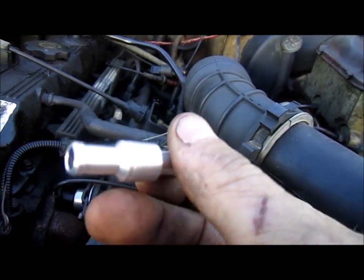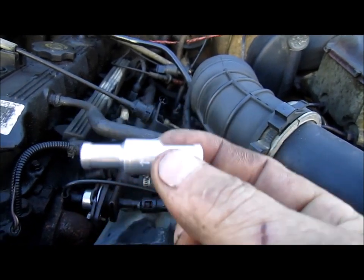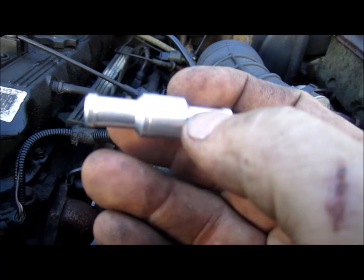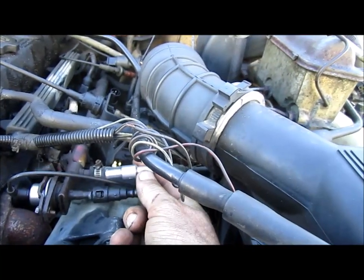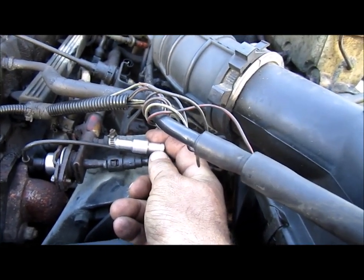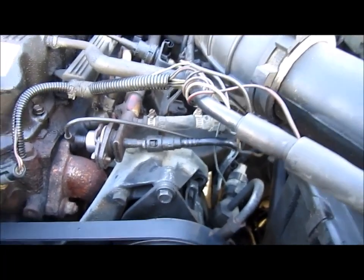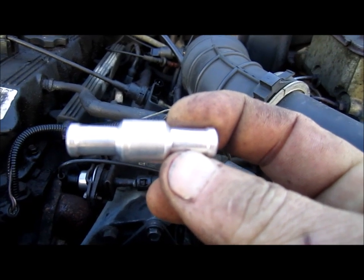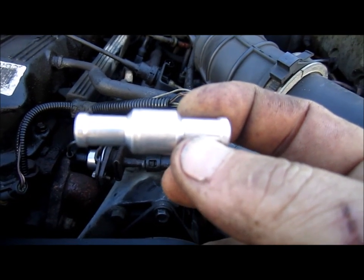If you want to try this, just make sure you get the right type of check valve — you don't want one that won't tolerate gasoline. This one will tolerate gasoline; the components inside are made from material that resists gasoline. So that's what I'm going to do: put this inline check valve in. If you're having trouble with your vehicle not starting up fast like it used to, and you've changed a few components and it's still not starting like you'd like, you might want to give this a try — it might help out quite a bit. Thank you folks for watching, subscribe if you have not, and thank you very much to those who already have.